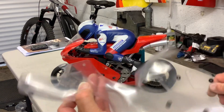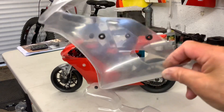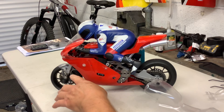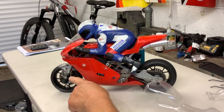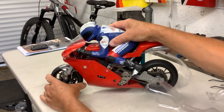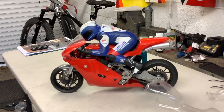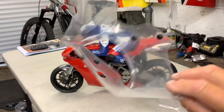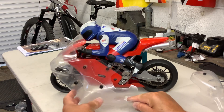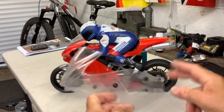I've got some new bodywork from Gregor - as usual he comes up trumps. I know it's pretty rare to find now. I managed to fit the front mudguard yesterday - absolute nightmare - because on the original TT it had the old-fashioned forks so the mudguard just stuck on with double-sided tape. On this one I've got to make it go up and down with the suspension, coming off the bottom bracket. That took me a long while to work out but I've got it working now.